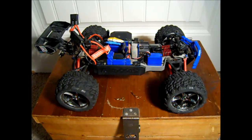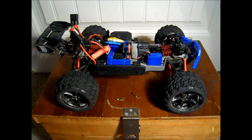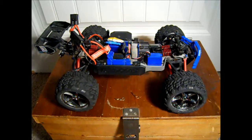The stock servo strips out. Personally, mine has done this twice. There is no alternative other than getting a new servo, but if it wasn't waterproof for these little miniature servos, then you're out of luck. The gears are like $3 for a whole setup, so it's no issue for me, but it's just something to consider.